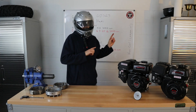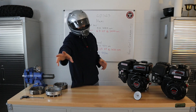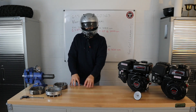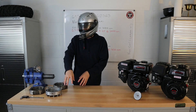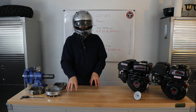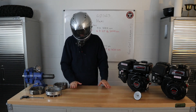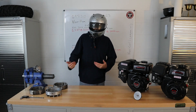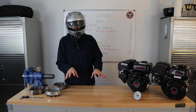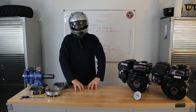Let's take a look at some results coming off of a dyno. When you use a dyno, I'm going to give you this little bit of precursor: my dyno can be different from somebody else's dyno. It's cold here with dry air, 65 degrees, very dry environment when these things were being run. There are a few different factors — elevation even coming into play. I've compared this with a few other people and I'm off by about 5%, give or take, on some of these numbers. But the comparison between the two engines remains the same.